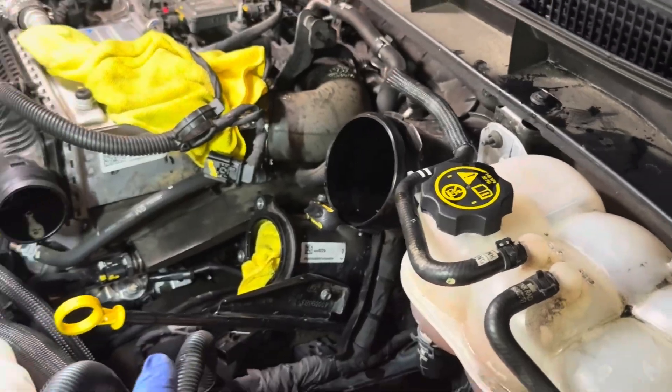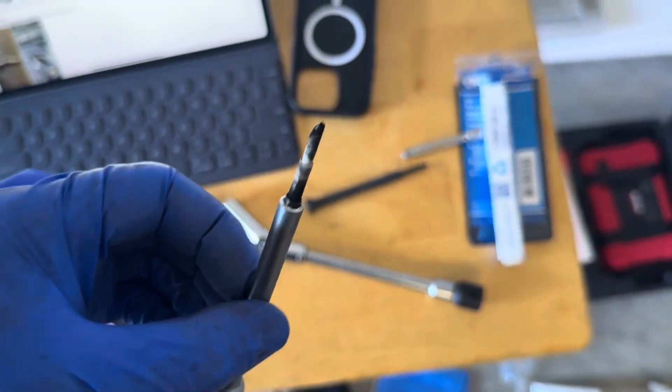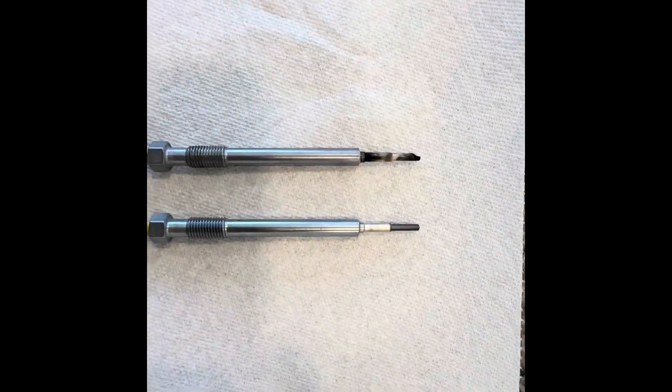I went ahead and removed the airbox so now I have direct access to the glow plug right over there — you can see the tip of it. I tried to unscrew it and hopefully with no trouble. This is what came out: on the left you see the piece I took out from the engine — it has a little edge that looks burnt off and came off. This is the new one. I went ahead and bought a kit to vacuum out the inside of the cylinder.